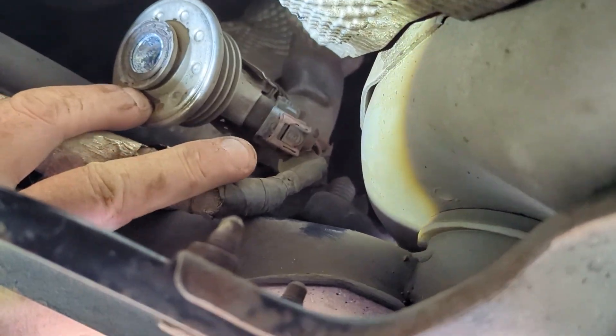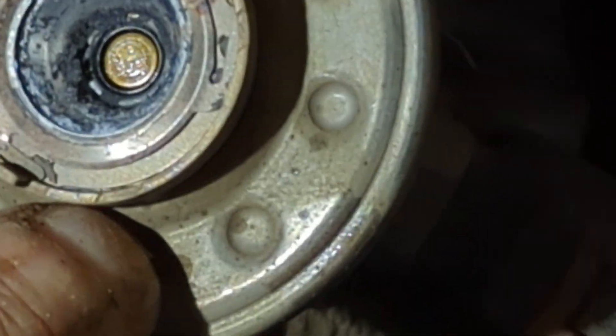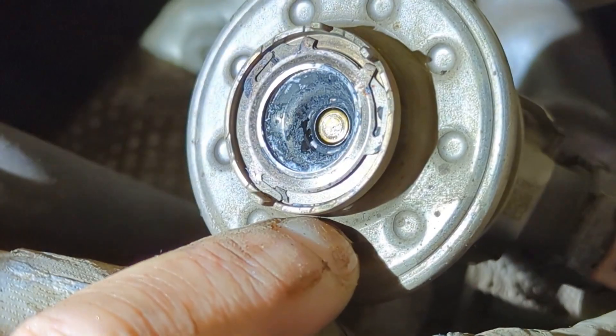Now that looks pretty clear to me. Can you just hold it while I zoom in on it? So there's the injection nozzle — it's looking pretty clean, actually. But switching to the injection port on the exhaust, that's what it looks like. You can see that grey material that's almost blocking the whole hole — it's just a build-up of crystallized AdBlue on diesel. So that needs to be cleaned out, and that could well be the cause of our problem. We're just going to get in there and clean it out now.